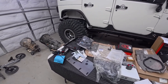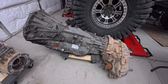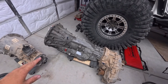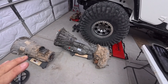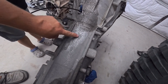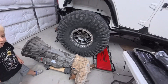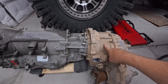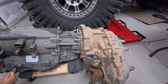To give you some background: the eight-speed I have here is out of a 2024 RAM 1500 four-wheel drive with a 3.6 liter. I bought this from a junkyard with a 12-month warranty, 12,000 miles, for $650. When you're looking for these they will say 850RE on the top — make sure you're buying the four-wheel drive model that has the adapter.